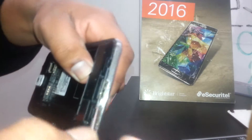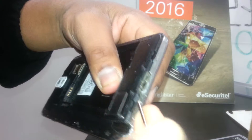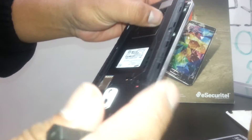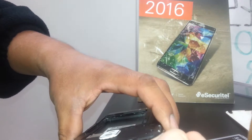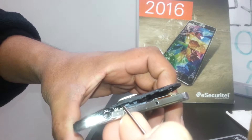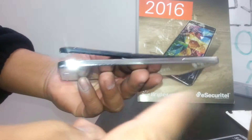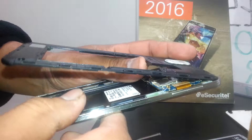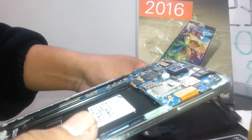We're going to pop this open and lift it. Just go around with your plastic opener or the screwdriver and then pop up the back frame. This is the flex cable from the touchscreen digitizer — make sure to be careful not to force the screwdriver over there as you may damage the flex cable, which I believe is the LCD connector.